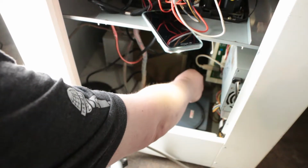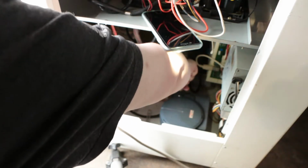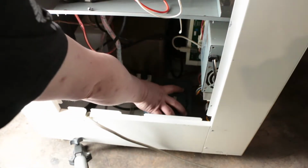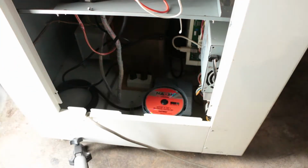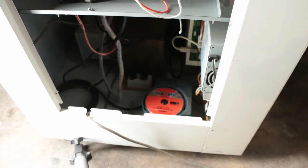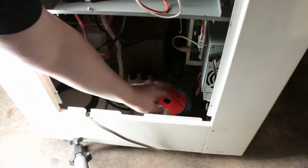So the first thing I need to do is take this screw off. It's a security screw to make sure that no one steals the game. It's kind of tight, and then I need to twist off the GD-Rom cover, which is actually sometimes very difficult. Sometimes I need a flathead screwdriver to get it off. I just pop the disc out, swap it, and then we're going to move on to step 2.